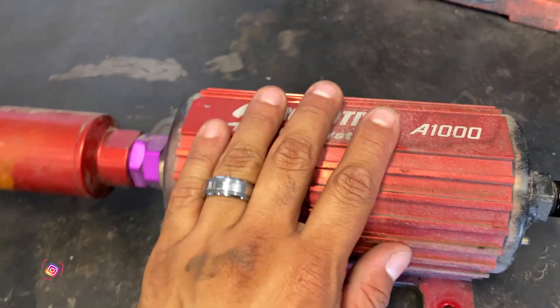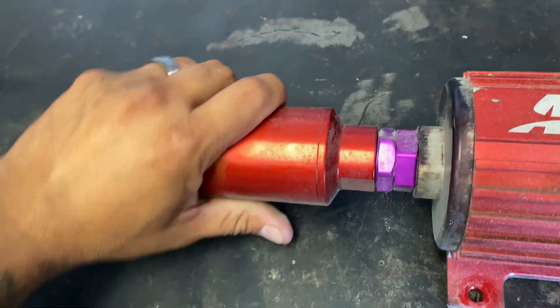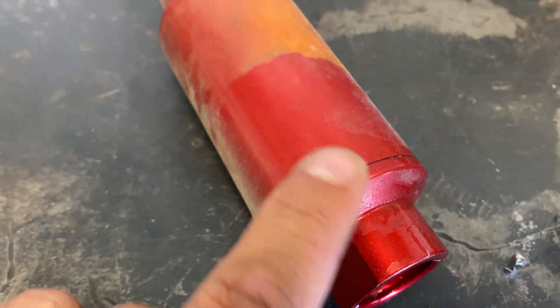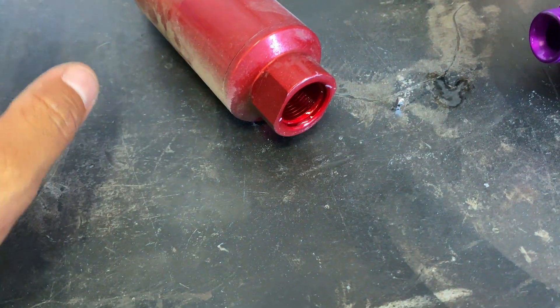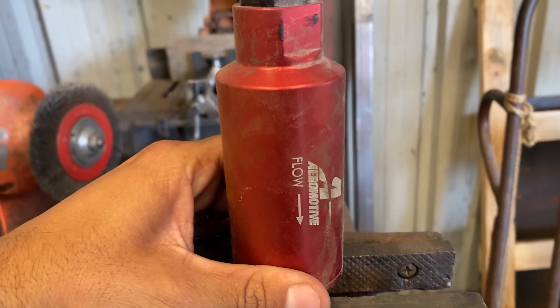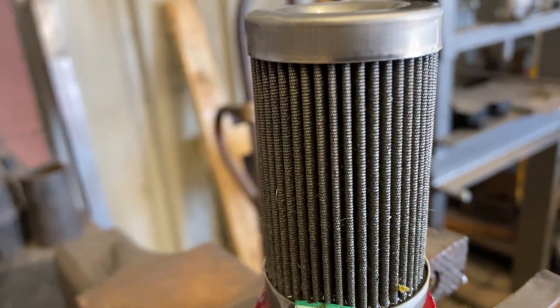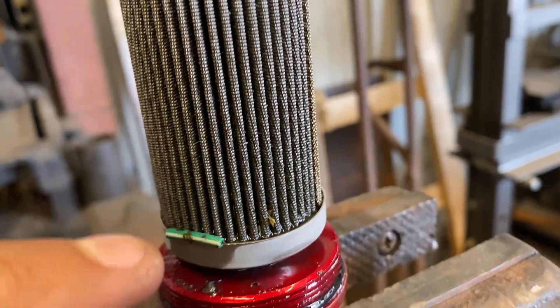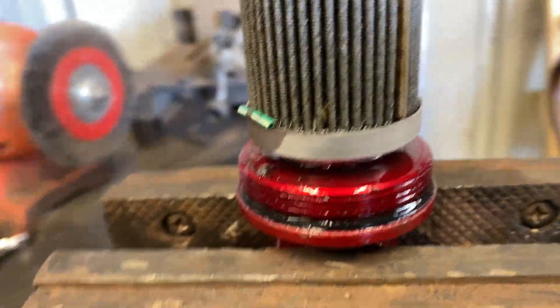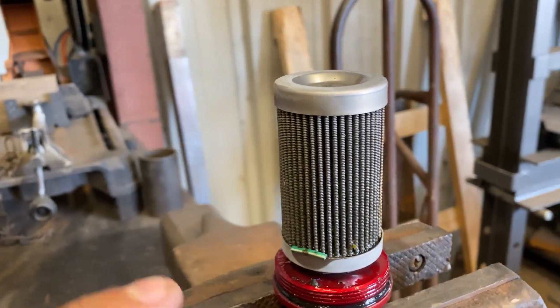Here's the old pump — same shape. Here's that big filter I was telling you about. We take this off, turn it, and it slides out. We'll pull the filter housing, clean that off, get some new O-rings. I put it in the vice to secure it, give it a crank — and there she goes. You can see all that stuff the filter saved: little pieces of metal, a little electrical tie, a little stuff here and there. It's always good to have this because you don't want that getting into your fuel pump or your injectors.